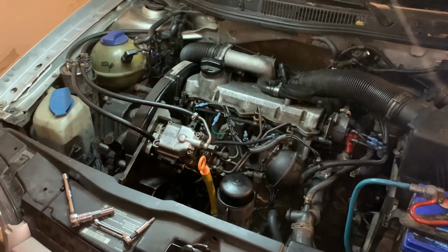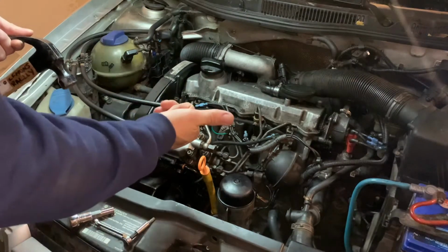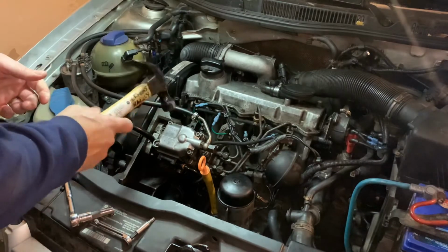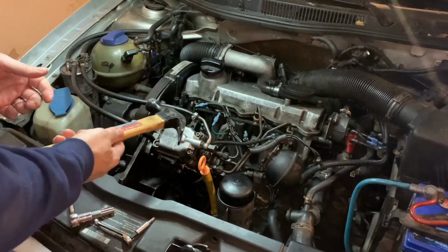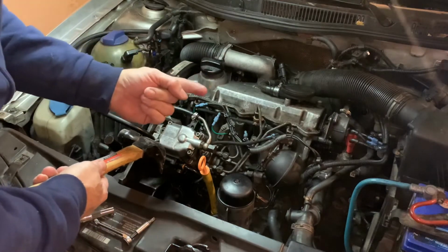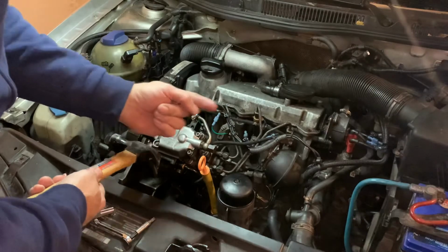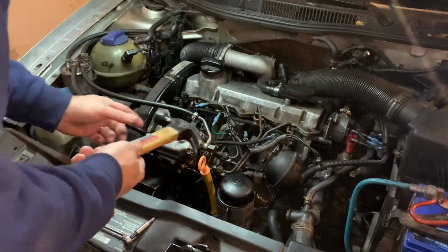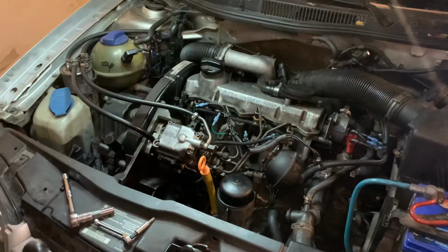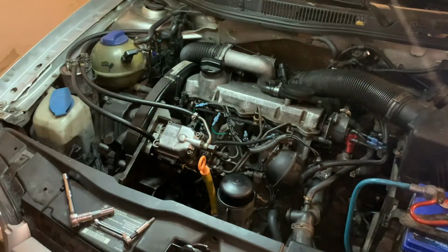If I'm hammering to the right, if I go past my marks to the right, that would be more. That's where you could endanger your engine running away if you're stuck too far to the right. I'm going to the left, so as long as I'm left of my scribe marks, I should be okay. That's a theory anyway. I need another light.